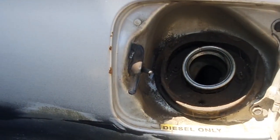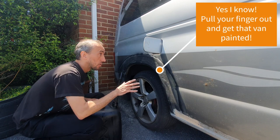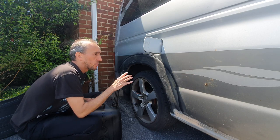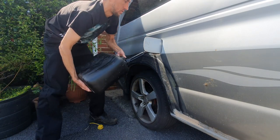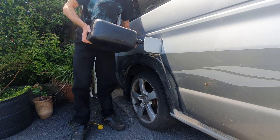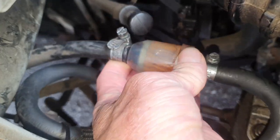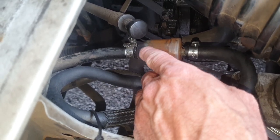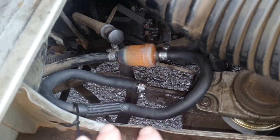This is all the old diesel that we took out — there's a mix of petrol, fresh diesel and all the veg oil that was in the tank when the pump stopped working. I've changed the pump and I've been for a couple of trips. We are pulling a lot of dirt out of the tank, so I think this tank needs to be dropped and cleaned. But it is running, so we are back on the veg oil and the diesel. I use these disposable filters in-line before the main diesel filter and I've gone through loads of them recently. There's a lot of particles in there — these keep getting blocked up. I think that is like some sort of algae scale that built up when the van was off the road for 18 months, so I definitely need to get my tank off and give it a clean out.